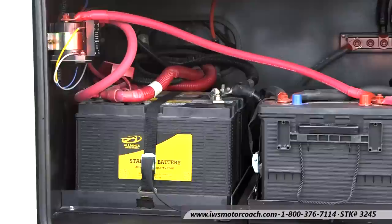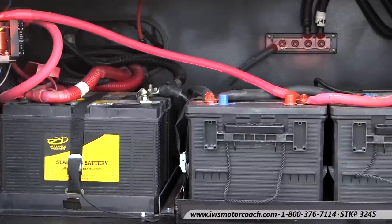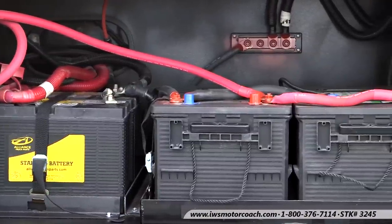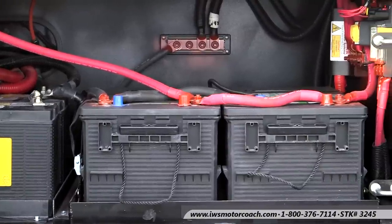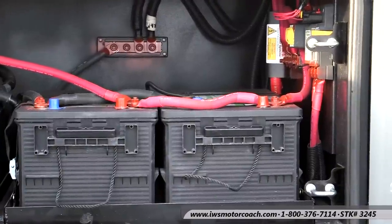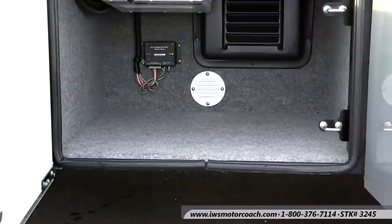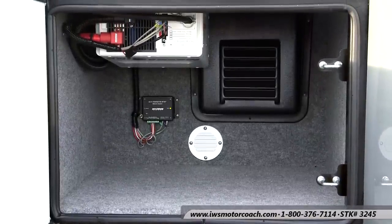By going to the Group 8D batteries, you're able to invert all night long. It's really a great option, especially on cool evenings — you don't have to run a heater or anything. It's just really nice to have that extra inverted power. Now we're going to go ahead and move to the next compartment back, and this is where the 2800 watt inverter is stored.